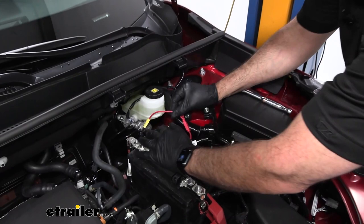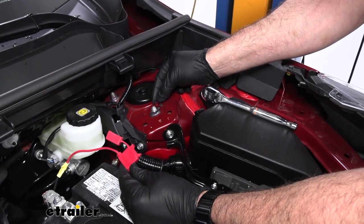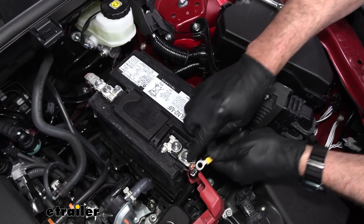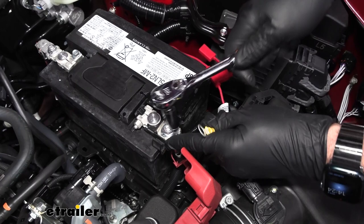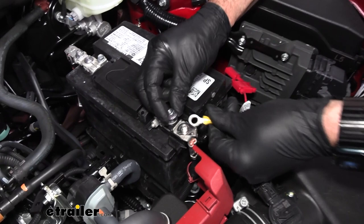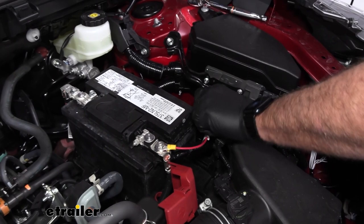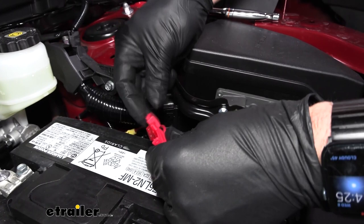That's going to do it for our connections at the back of the car. We went ahead and made the connections with the supplied butt connectors. This is our power wire coming from the back of the car, and this is the supplied fusible link — it does come with a fuse, which we'll put in at the very last step. I'm going to run this around behind the battery and connect up here. This is a 12mm socket. Of course, you want to be careful since your battery is hooked up — you can either disconnect the negative to do this or just be careful where your metal wrench is going. Tighten that back down, then insert the supplied fuse and put the dust cap on.